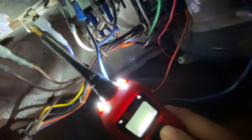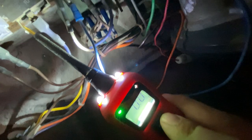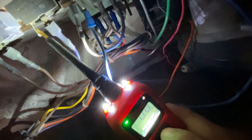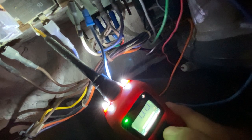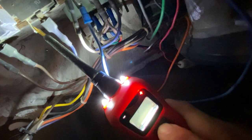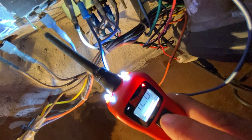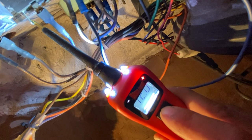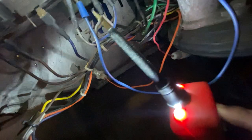Aha, I found my problem. There's an empty terminal. This blue wire actually just goes to the light itself, so it doesn't have power in the switch. So if I touch this and put power to it, I get a good connection. I can see now I've got 12 volts — sending 12.4 volts to that light. That light's coming on now.